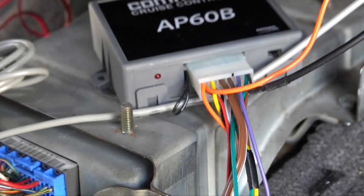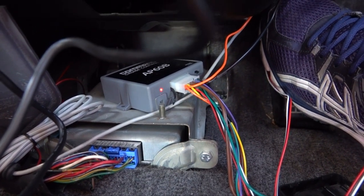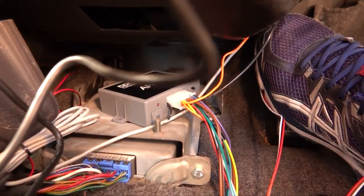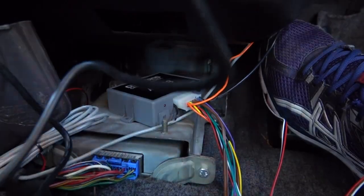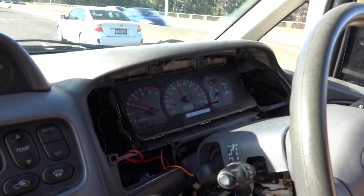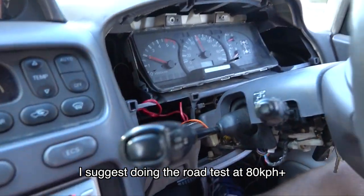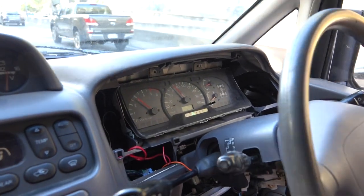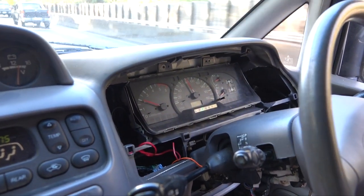If you have problems with the cruise control not engaging, I found that it wouldn't engage unless I cut this small black wire. As we're driving along on our third test, you should see the red light of the control unit blinking as you drive — I'm on the brake right now which is why it's solid red. As I drive along with foot off the brake and accelerating, you should see a blink — that's the speed pulse, so it's reading the speed pulses, which means it's working. We're testing the cruise on the motorway doing 80. I push On to turn the cruise on, then push Set — it takes a few seconds for the cruise control to pick up and take over, we think because of a bit too much slack in the cable. But now my foot is off the gas and the cruise control is taking over, bringing us back up to 80. It seems to be working quite well.